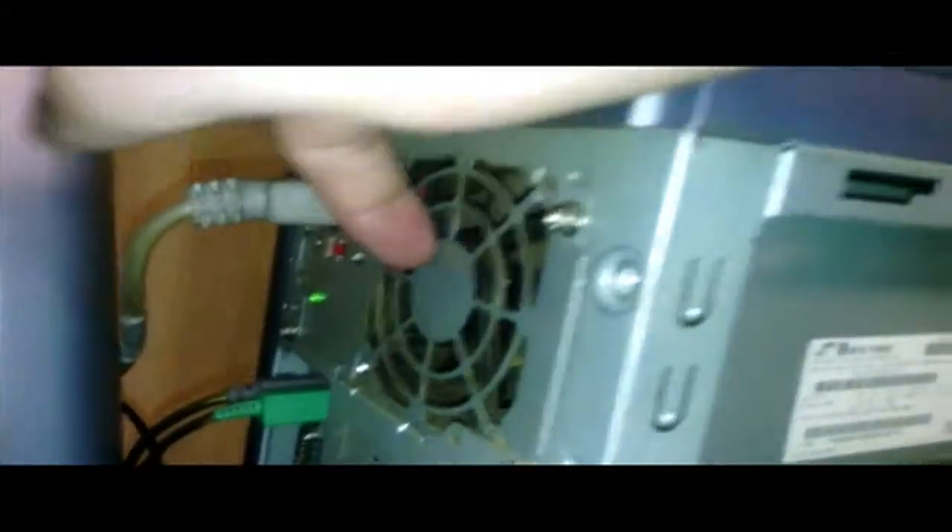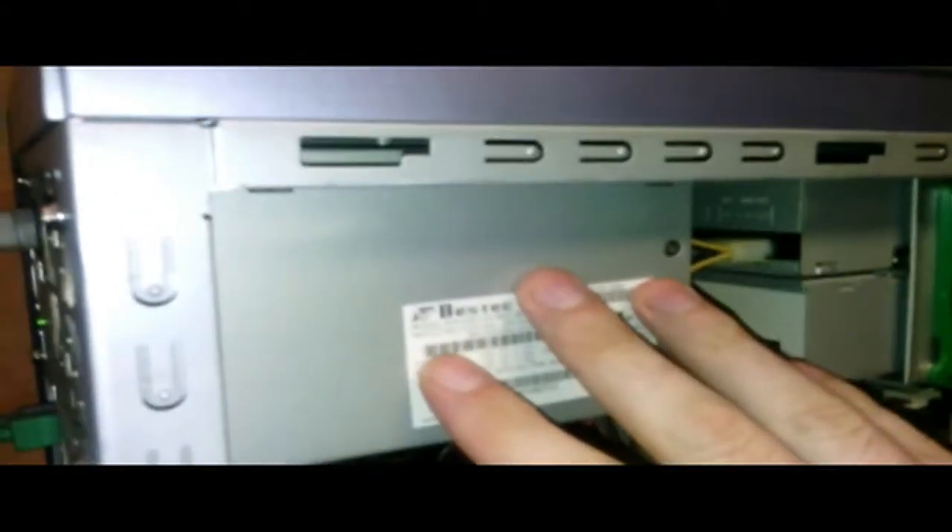If your light's not on, it indicates one of two things: either you're not receiving power at all — which is why I say check the obvious first — or it could mean that your power supply is so badly blown that the light's not working, though I rarely see this. For computers without a test light, if you turn on your computer and the fan doesn't spin at all, or it tries to spin but kind of just jerks, that also indicates a problem with the power supply.